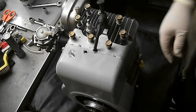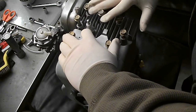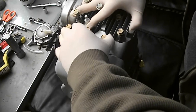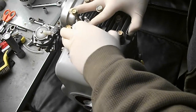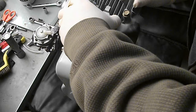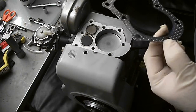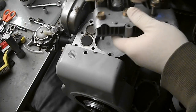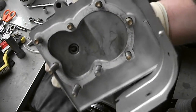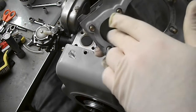Okay, that's done. I'll carefully try to remove the heat shield and all the head bolts together if possible. It's coming along — trying to raise these up a little bit. There we go. Looks like we have some oil on the piston. Let's go ahead and take a look at the cylinder head. I've got some oil in the cylinder, but that's kind of common with a recent rebuild.